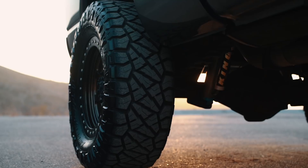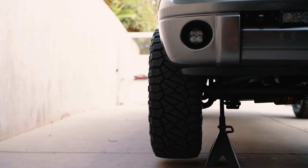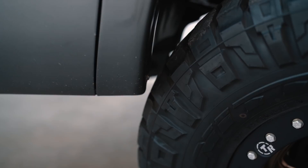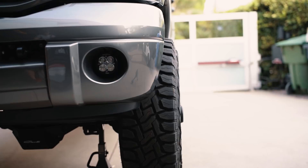If you want to really push it, what I have on my truck is about as far as you can possibly go without really cutting your truck up. My truck has a 5.5 inch backspace, 9.5 inch wide wheel, which is around positive 6.8 offset, mounted to a 37 by 13.5 wide tire. I have seen people run zero offset 4.75 backspace wheels with 37 13.5, but to me that's a little bit too much trimming. If you are looking for minimal trimming, plus 18 to plus 25 offset and a wheel no wider than 9 inches is going to be your sweet spot. Anything outside of that is going to require more trimming or just won't fit at all.